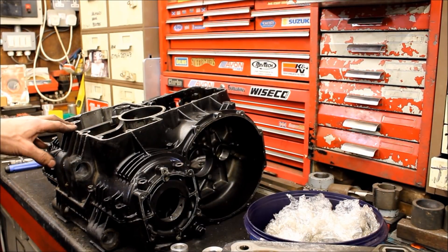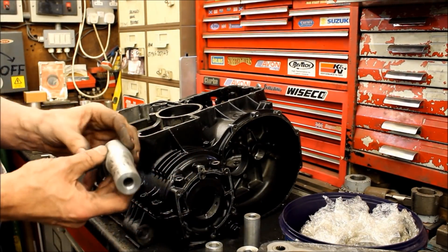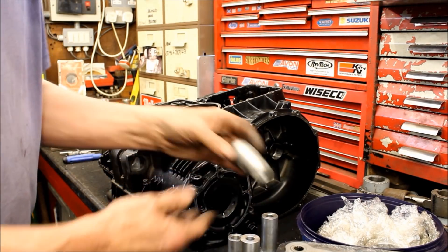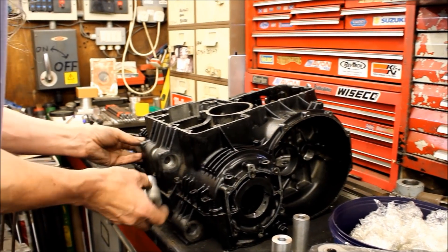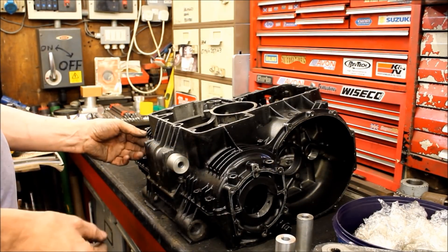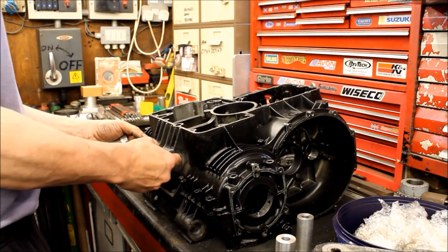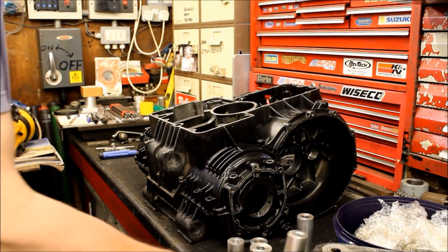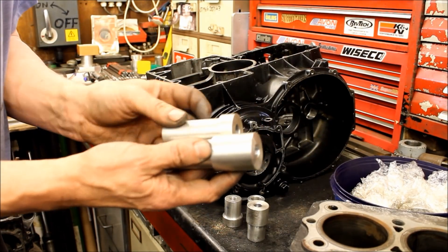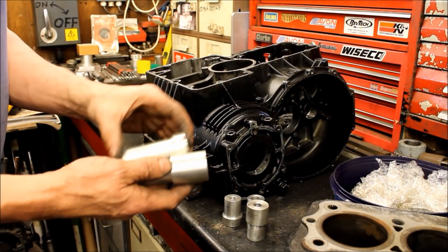Jeff, what are you up to today? You're cleaning up those cases. While I was having tea he found some solid mount inserts — they were actually made for the GPZ cases to replace the rubber mounts, and we don't want rubber mounts. They slide in and with super-duper Loctite on them they're going nowhere once in between the brackets. So basically we're changing from rubber mounts to solid mounts. For the front ones we need to make a spacer to go between. That spacer needs substantially machining down — they only want to be about 10 to 13mm wide for the bracket.